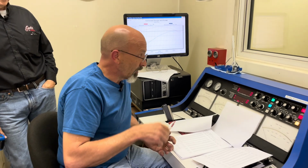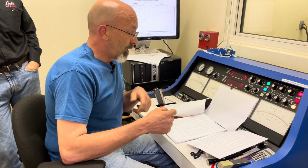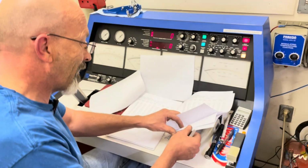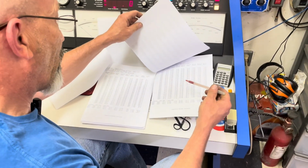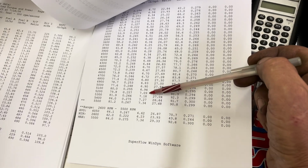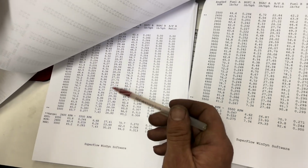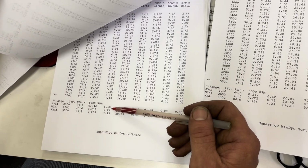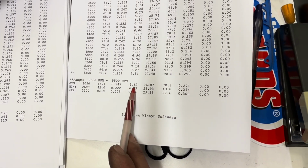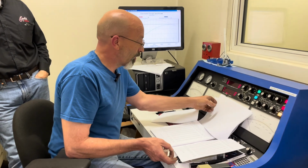So you guys saw the collectors that I had on before, and they're probably 12 inches long. We were looking at the dyno sheets, and there's one section called the brake specific air consumption. I can explain all that, what it means later, but on this chart we were getting up into the 7s. And the previous one was even higher because that was with the long collector. This is with the shorter one. Our average brake specific air consumption was 6.68 with the long collector. We put the short collector on, we dropped down to 6.62. That's about as best we're going to get and still be able to make torque, because you want scavenging to help pull the charge in.